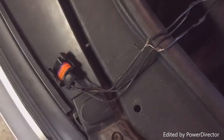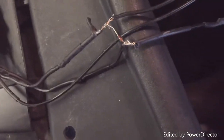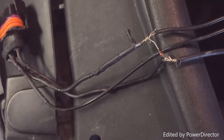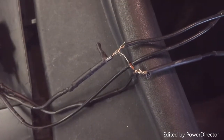To figure out if you have it in the right way, go and start up your car. I had this problem once where if you have it installed backwards, sometimes the car won't even start depending on what diode is in there. My car started, but when you'd go to rev it, it would break up and I had a check engine light. So if that happens to you, you know it's in backwards.